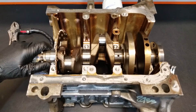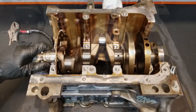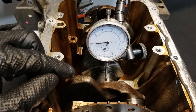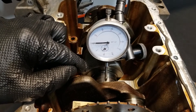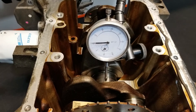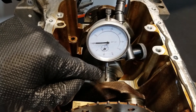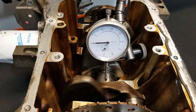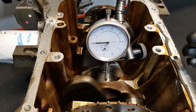If we had a four-cylinder engine, V8, or even a V6, we might have an odd number of main bearing journals which would give us a true center to measure on, but we'll just make do with this one. We'll pick one of these two journals to measure for run-out. I'm going to set up the dial indicator right now, and as we spin the crankshaft we'll be able to check for run-out. With our dial indicator mounted and in its proper position, we can go ahead and turn this crankshaft to inspect for any run-out.